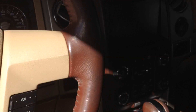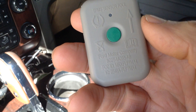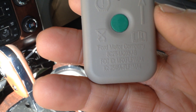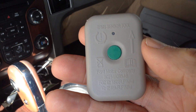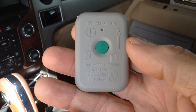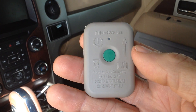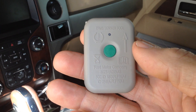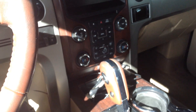Let me do the procedure. I've got two tools: this TPMS-19 tool — you can search eBay for that Motorcraft number and find them for about $35 to $40. It sends out a triggering frequency, a very low frequency 125 kilohertz signal that triggers the sensor to transmit and send its data to the TPMS computer. I've got another tool here I'll show you later — let me get it booting up.